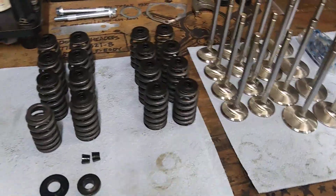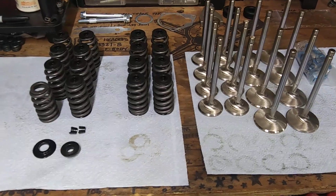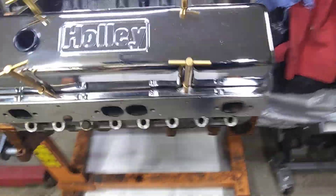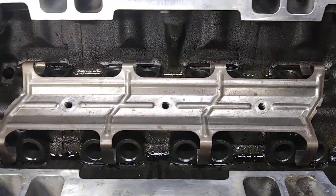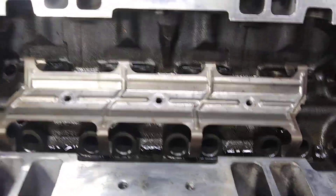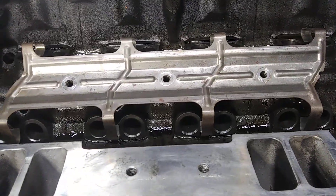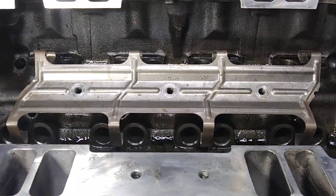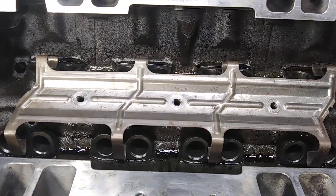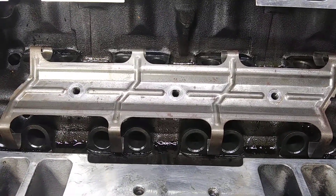The main thing is you're going to need a block — like a late 80s to 90s block — that has the provisions for the spider and all that. Use the dog bones and factory type lifters. I'd trust it up to about 580 lift, and beyond that go with the vertical bar lifters.